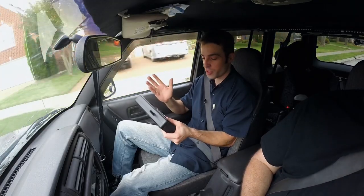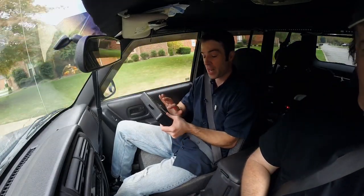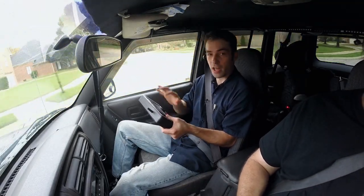On channel one and channel four I'm picking up very faint signals — very slight audio and visual cues. On channel three I'm getting almost nothing, just kind of road noise coming through. On channel two that's where it's the strongest, so more than likely our problem is close to that number two transmitter.